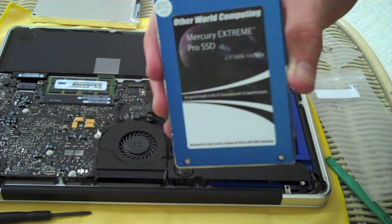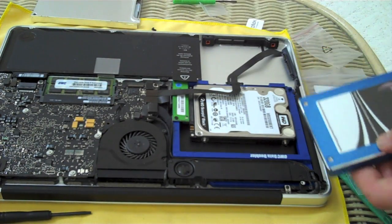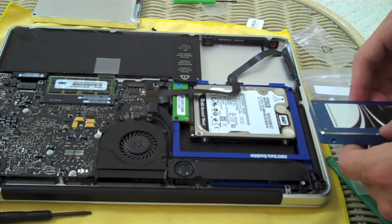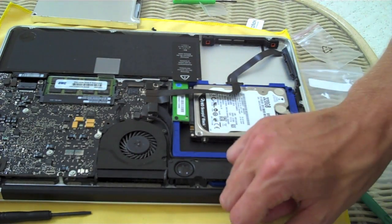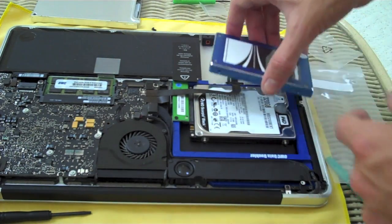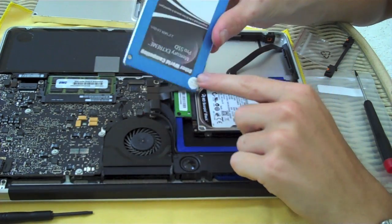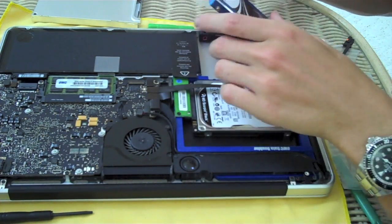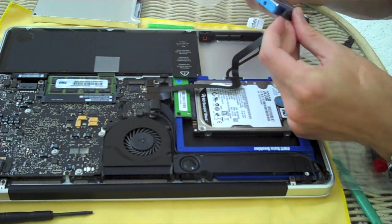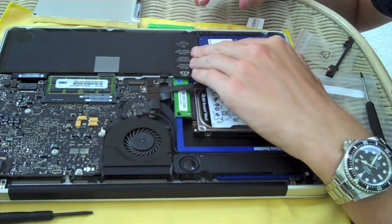I just took the SSD out of its plastic enclosure — this is going to be probably the easiest part of the whole thing. I'm going to take the two pegs off the hard drive that we don't need and put them on the SSD. Too bad they don't give you four — they should include extras with the Data Doubler; that's my only complaint so far. Then we'll just put that in using the same data cable the old hard drive used, making sure the data cable goes under the SSD, line up the pegs, and we'll be good to install OS X.